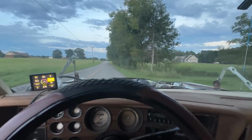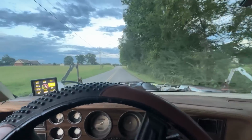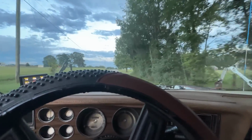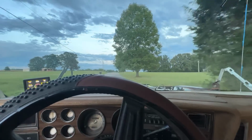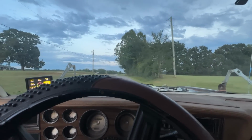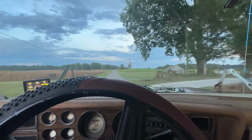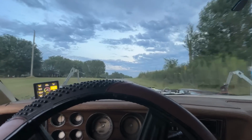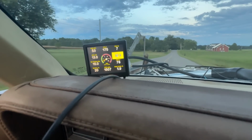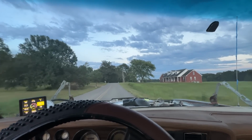I also hooked up the kickdown linkage because it was shifting short. Let's see how it does now. Oh yeah, shifts much better. I know the transmission was acting funny, so I was getting nervous, but I forgot to hook up the kickdown last time, so that was what it was. It honestly drives pretty nice, you know? I'm loving it though. It's honestly pretty tame. It's quiet, y'all.